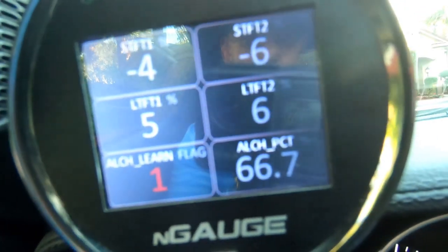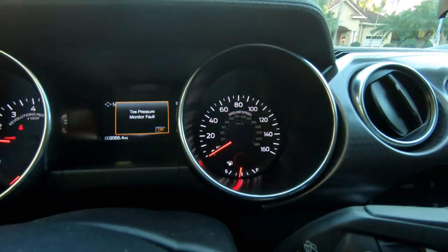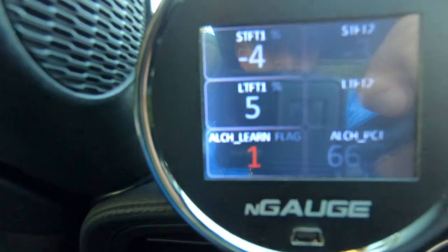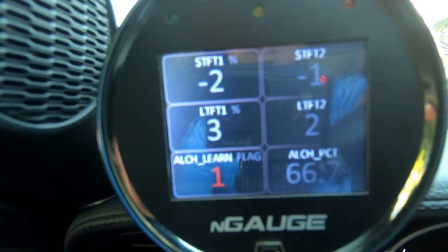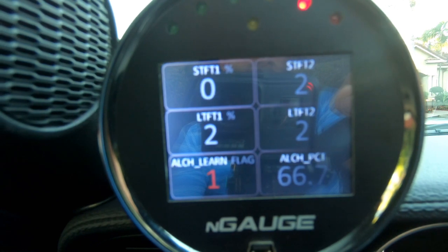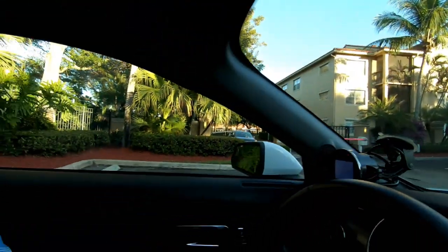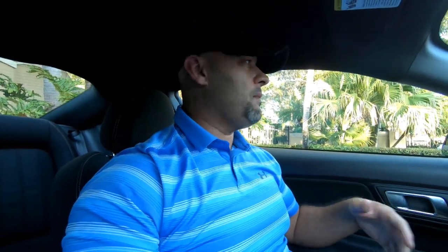You can see on the bottom right it says 66% alcohol percentage. I'm going to go to the gas station — I have just under a quarter tank — fill up with E85, and see what it learns. The goal is to get to full E85, hoping it learns up to at least 79% or so, and then I'll install the dedicated E85 tune. The flex fuel tune allows me to run any percentage of ethanol. A dedicated E85 tune is just that — dedicated E85. A lot of people ask: when you go from a flex fuel tune to a dedicated E85 tune, how much do you gain? You'd be surprised — peak horsepower on a dyno might be exactly the same.